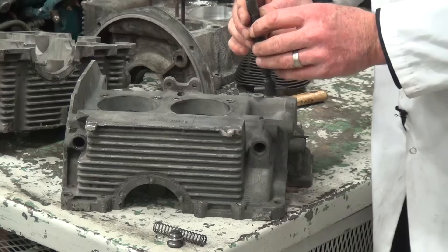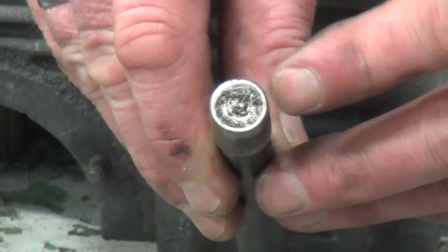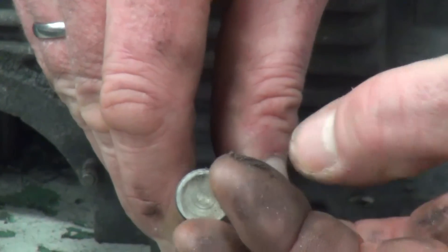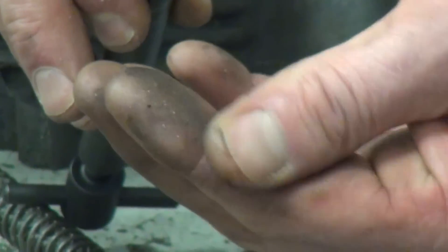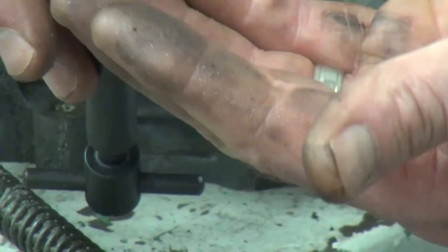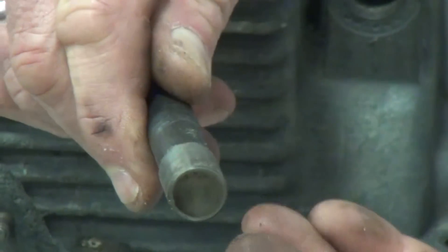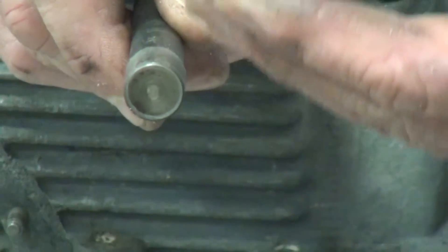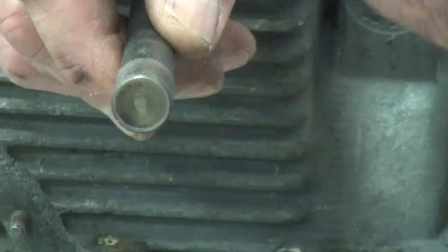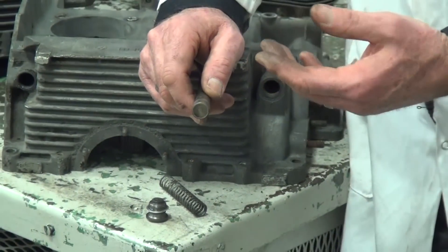The important thing here, if we take a look, you can see the debris sitting underneath that piston — there is some grinding compound, maybe some sand, some carbon, some soot, lots of debris from the cleaning. Leaving this in the engine during a build can actually cause a defect, especially if these valves are not moving and controlling the regulation and pressure relief of the lubrication system oil pressure.